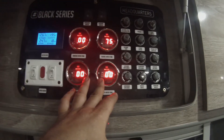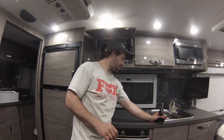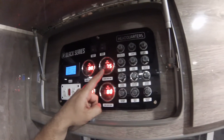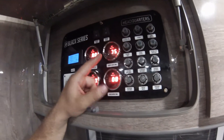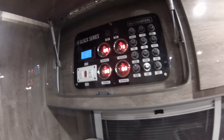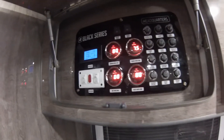These are all your tank gauges — now these do work in different stages, and it took me a little bit to figure this out. Basically those things only work in a couple of stages: the gray tank's got 75 in it, it'll next step go to 51%, then 38, then around 24, they'll flick between, and then of course go to zero. So there's about five or six stages they actually work in, they'll go to 100% if it's completely full.